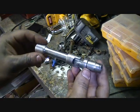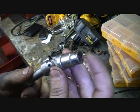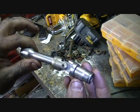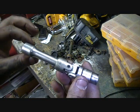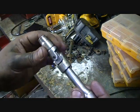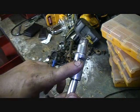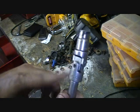This is relevant to the work today. Without this little universal joint — short piece, little 10mm — I never would have got that top bolt re-threaded. Re-threading that top bolt took more time than doing the whole job. Without this, it wouldn't have been possible. So get yourself a universal joint, or else you will not be able to re-thread the top bolt without removing the intake manifold.